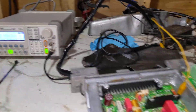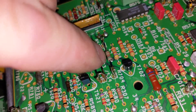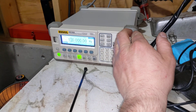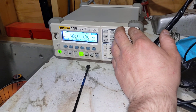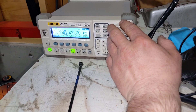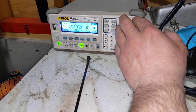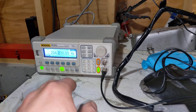The goal of this is to adjust the rev limiter. I know that little component right there determines the rev limit. So we're going to find the rev limit first — sweeping up the frequency. Cut off right there. Going back to 290... 292... 294. There it is. There's the rev limiter right there at 294.5 hertz.